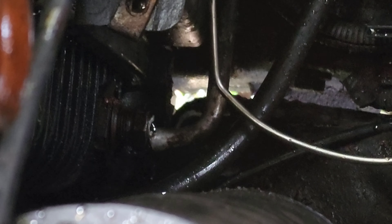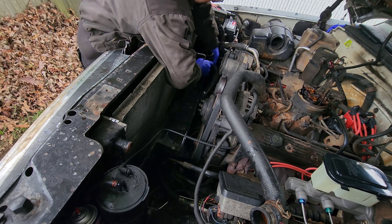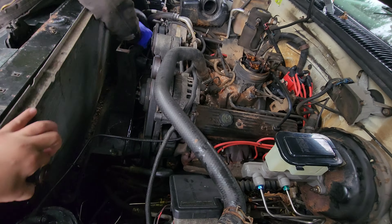We're ready to take the radiator out but we had one problem with the oil cooler line — one of the fittings snapped the aluminum line. We're going to have to get a new oil cooler line, but the transmission cooler lines came off good and easy, so it's not a crazy job. It would be bad if both broke at the same time. We got the radiator out, just taking out this last pipe, releasing with two clamps on either end, leaving the shroud in and pulling it up.